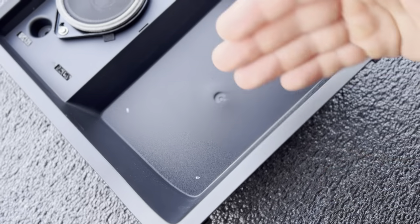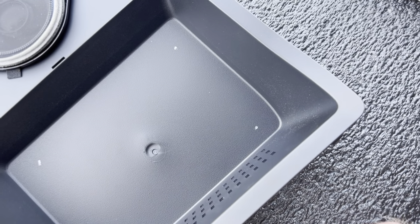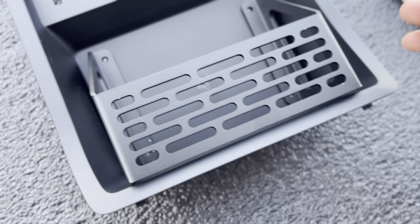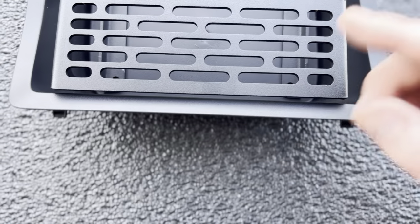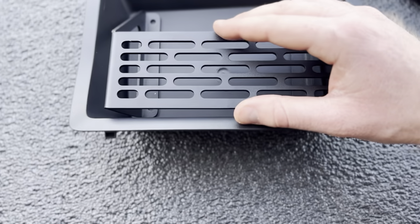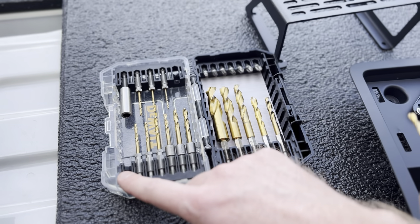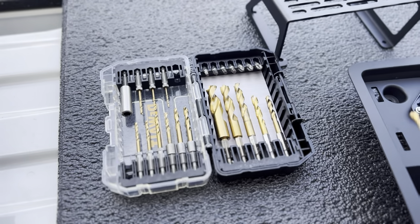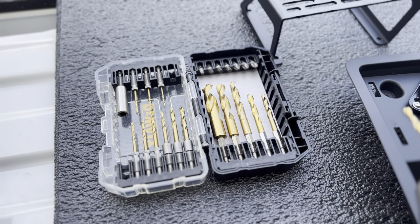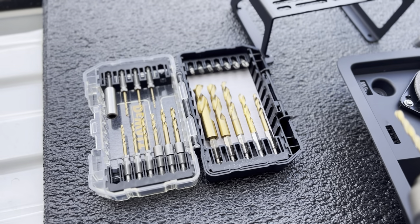One thing to note: in addition to being sloped towards the driver, the tray itself is also angled slightly towards the driver. The marks I made are not entirely centered because I'm trying to align the lip of the panel to be even all the way across. You can angle it towards the driver, have it set back — there are options. As always with this kind of stuff, start with a drill bit smaller than your final hole size. The final hole size is quarter inch, so start much smaller and work your way up. If you're in a cold climate, this is especially important because the plastic can get brittle and you could crack the tray — so always start small and wait for warmer weather if possible.